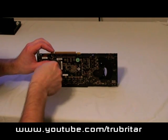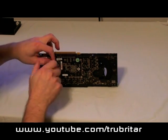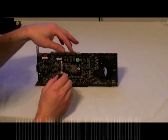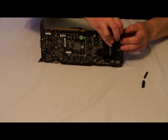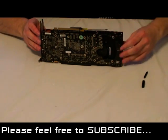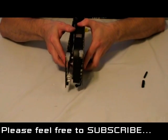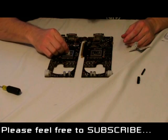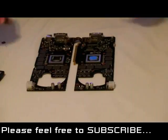Just remove the 12 screws on the top of the card and the 12 screws on the bottom of the card. When we get all the screws off, we need to unplug the fan. Now we should be able to pry those cards apart. When you've got the cards apart, just remove the DVI bracket and the heatsink fan assembly. Now clean the GPUs with an alcohol swab, the PCIe chip, as well as all the other memory chips, voltage regulators, etc.